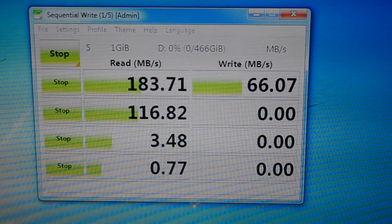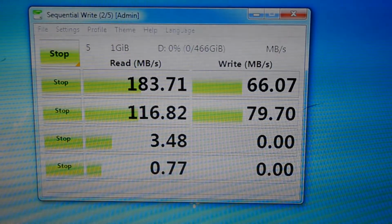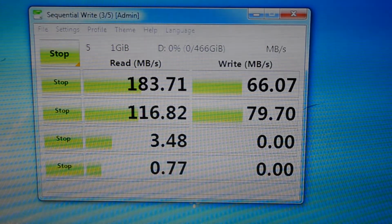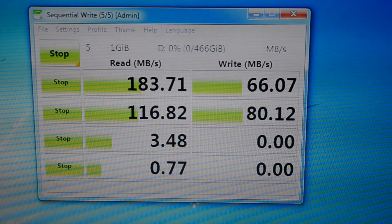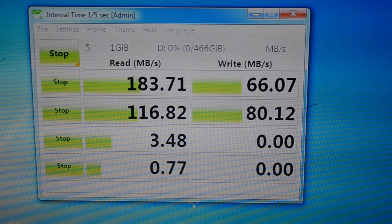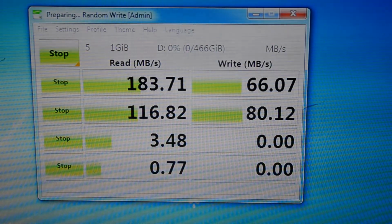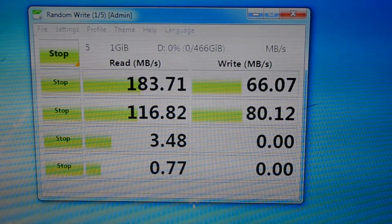Quick update on the Seagate drives. I got a second one, put it in my NAS, and I'm running a mirrored array on them for reliability. So in case one drive fails, the other will still be running. But remember, RAID is not a backup. I also have a backup drive. Now, I wouldn't have covered this because it's not super interesting, but the drives are actually faster in RAID. And I didn't expect just a mirrored array to make them faster.